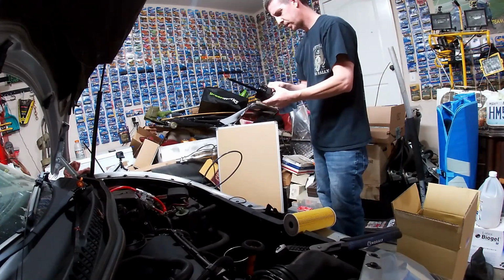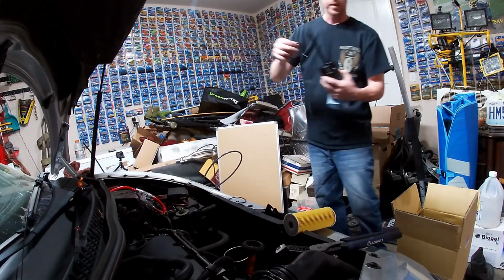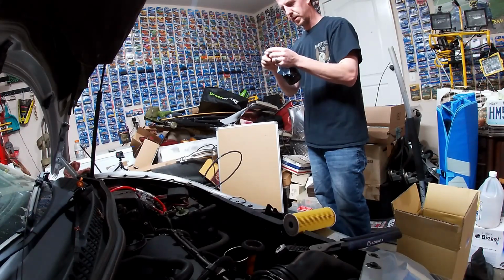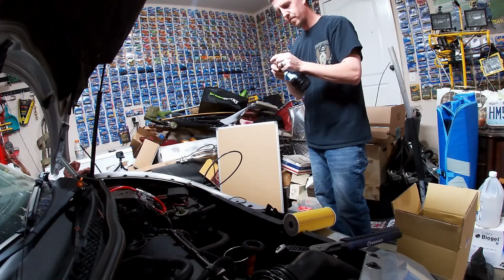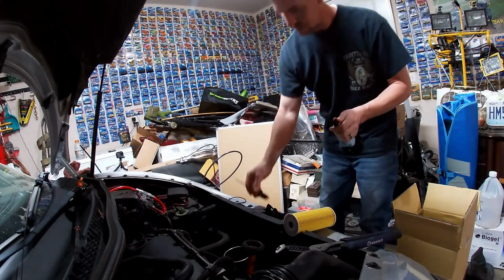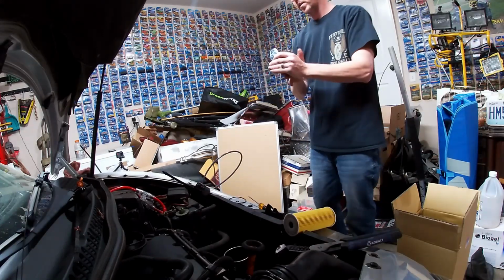Still full of oil, as you can see. Take your screwdriver. Just kind of get in there and pull that thing out. Now work it around. One O-ring off. Now, you want to be careful. This center section is not near as strong as the base. Take your little screwdriver, or pick if you've got it. Get in there and hook that little dude. And just work it right off the end. One little O-ring. There we go. We've got the old O-rings out of the way. Set that off to the side for a second.